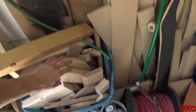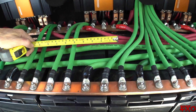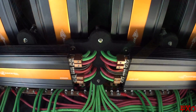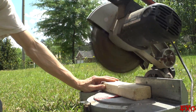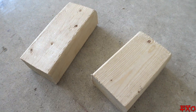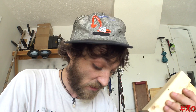Let's go ahead and go to the spare bin of life. Look at that — two by three. We may even use this or this two by four right here, just cut a little pieces and then throw some carpet on it so we don't have to see what they look like. Just some simple standoffs to get the job done — just need to deburr them a little bit before we carpet them with our budget Loctite spray. We usually do Super 77, but this stuff was actually like three bucks cheaper, and it works fairly well on this cheapo carpet we got from Bargain Express. We're going to use this recycled piece from our Dropin' Hertz woofer box on only the parts that we're going to see, to save as much carpet as I can.